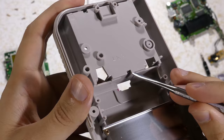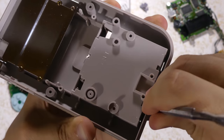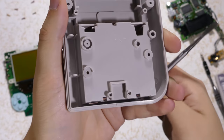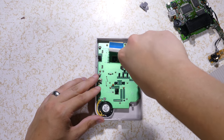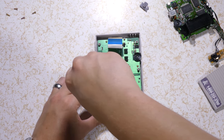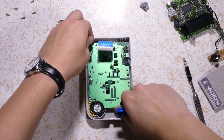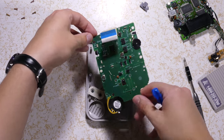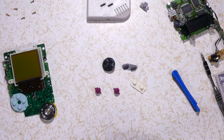You may also remove the battery tabs by using a small pointed object to press down the smaller tabs from the inside of the casing. For the front half, unscrew the ten Phillips screws and pull the board free. There may be adhesive sticking to the front of the screen, just gently pull it straight out. Take out the buttons and rubber contact pads and there it is, all apart.